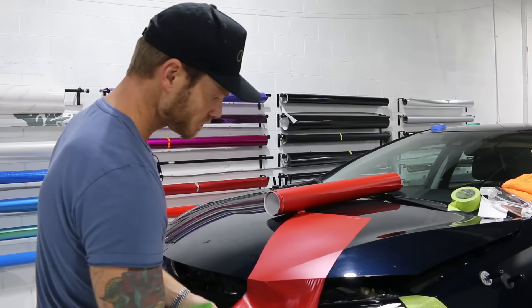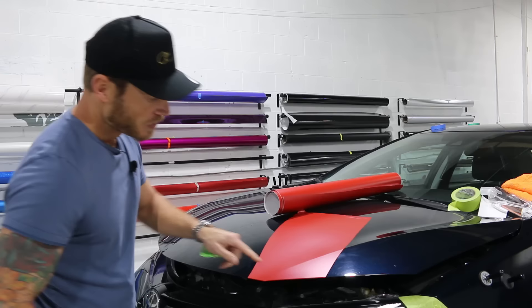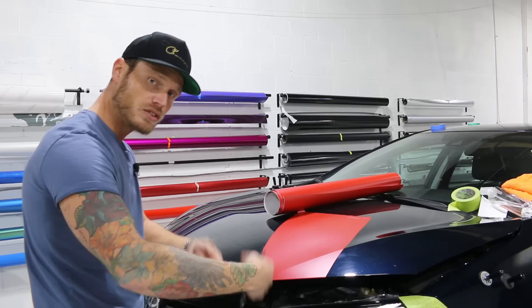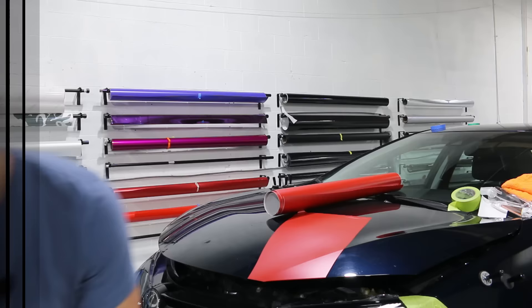But on top of that, let's get down here now. I heated and pulled the film down to this edge. The problem here is that we just drew all the tension down to the edge. When we draw the tension to the edge and cut it off at the bottom, the film wants to retract back. If we had avoided that with a three-direction stretch, the film would want to pull in at the sides and back, helping it curl around the bottom side. I just stretched directly to this edge — let's see what happens when we add heat.